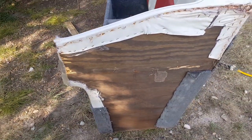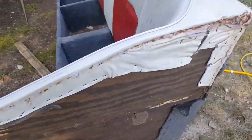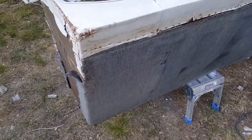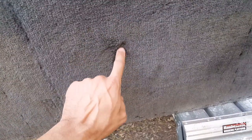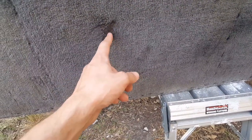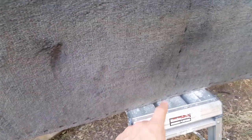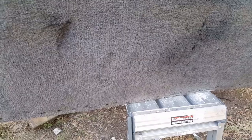You can see here we're gonna capture this angle on another piece of plywood — I think this looks like half inch. I'm considering building everything out of three-quarter, it just holds together a little bit better. They also had carpet back here. I noticed this when the seat was in place: this is where you have the water separator, the fuel filter, and then this is where the nozzle was coming and actually hitting that part of the engine. There was kind of an oil spot too because this is where the harmonic balancer and the assembly for all the belts is — it's all right there. So it's a little too close, so I'm actually gonna push everything forward a little bit and change some things.